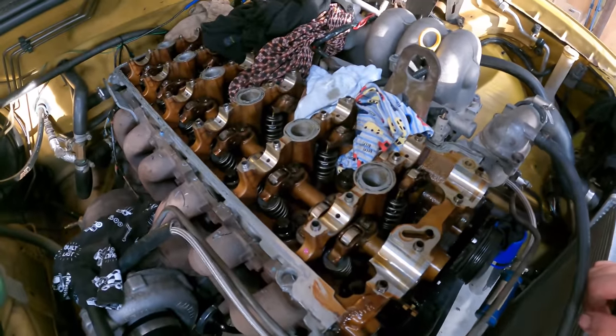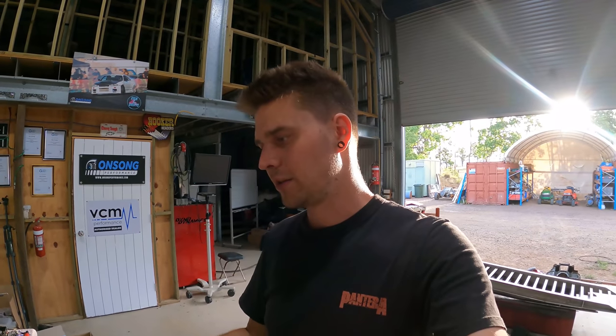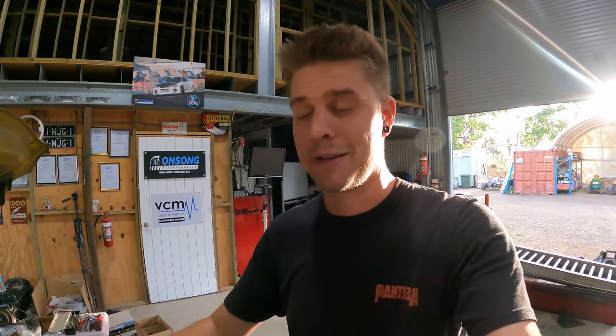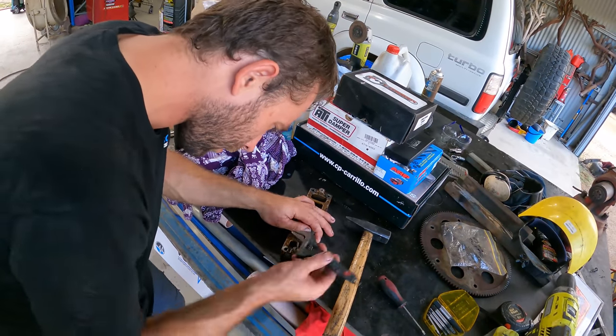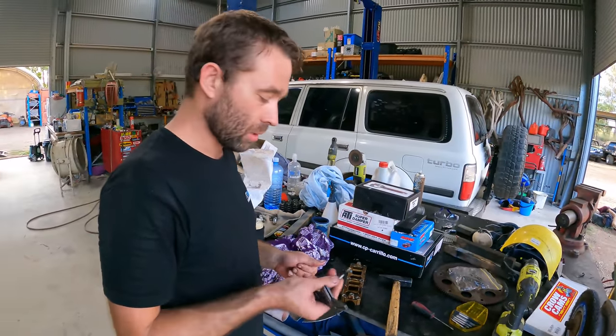We're working on cleaning up all the RTV from the previous work - this top cover is a rubber seal anyway, you don't need RTV. It's crazy how much they put in it. We've got it down to the point where it takes us just as long to do that back cylinder number six as it takes to do the other five combined - about two and a half hours total for all the springs once we're to that point. Rex is working on trying to get those snapped bolts out of the cam caps using an easy-out. One came out, but the other one had already been butchered by someone - not going to happen.